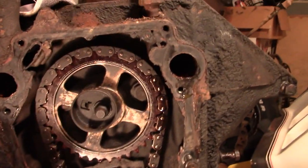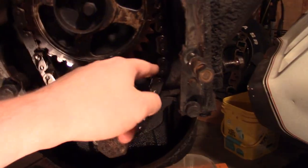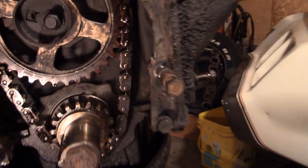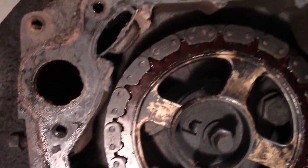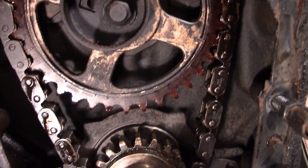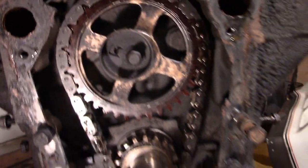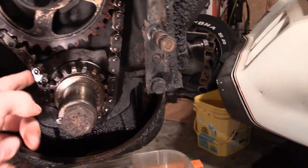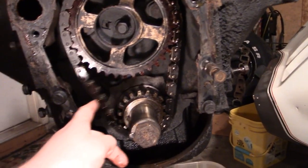Check this out — this is a rare occurrence. This engine's got mileage on it; you can see all the play in the chain. But what do you notice is different? Look at the cam — all the nylon's still on the gear. You never see that. I told my dad about it and he freaked out — he said you know why it's still there? Because it wasn't on any of our cars. I've never seen one where all the nylon's still there. But still, the chain's stretched. You can see — move it all to one side, that's what you're looking at.